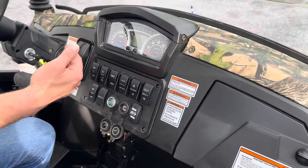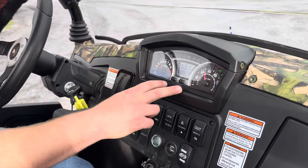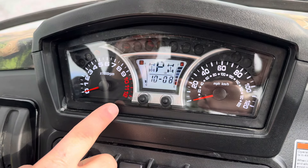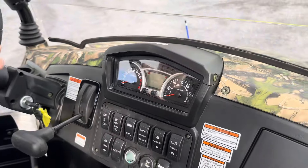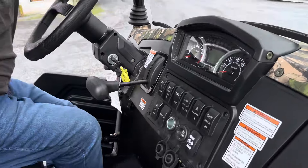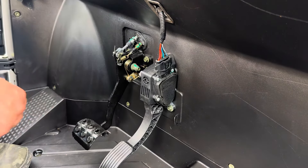The transmission has low, high, neutral, reverse, and park. We've got a digital instrument cluster with speedometer, tachometer, fuel gauge, cooling gauge, and it tells you what gear you're in and whether you're in four-wheel drive. The 750D has power steering and a tilt wheel. We've got the park brake and a cup holder. The 750D is also fly-by-wire — there is no throttle cable; it's all electronic.